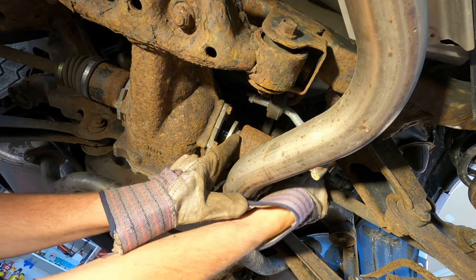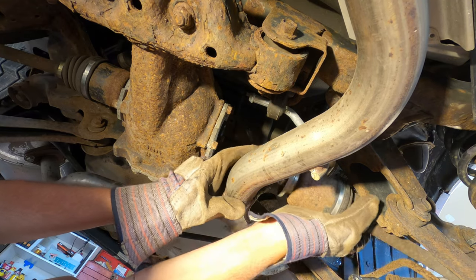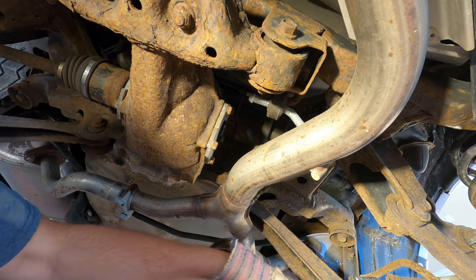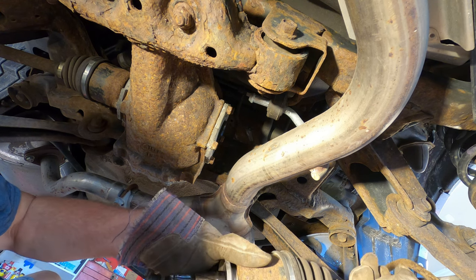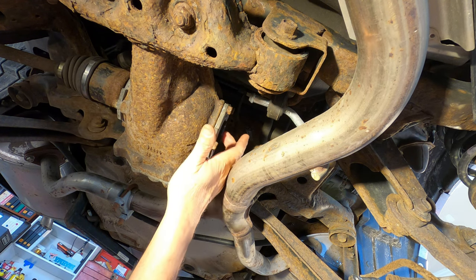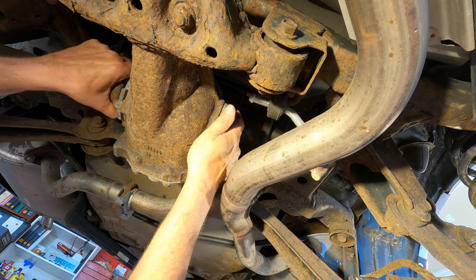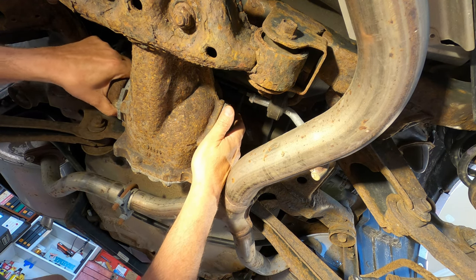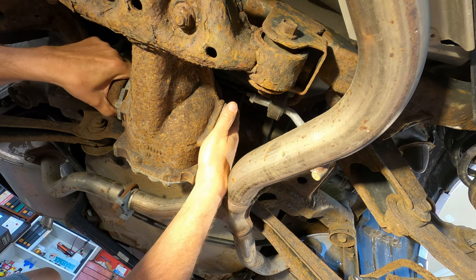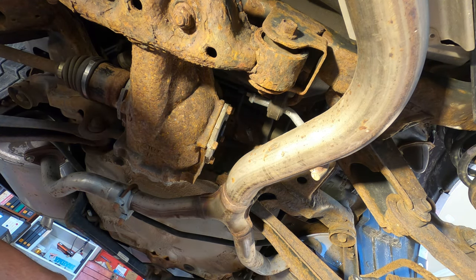I wasn't completely sure these original high mileage CV joints weren't the problem. They're easy to remove when the hubs are out of the way, so I popped them out to look at them. I also wanted to check for any movement or roughness in the differential bearings. When I moved the axle shaft on one side, it couldn't be felt on the other side. That didn't cause any movement where it shouldn't. Well, the good news is I don't feel any movement in there.